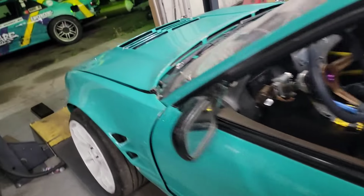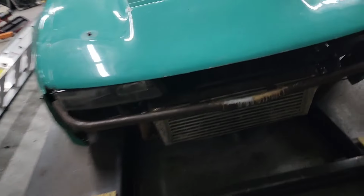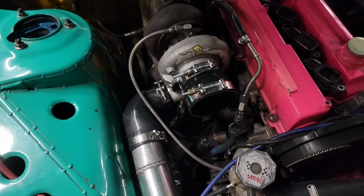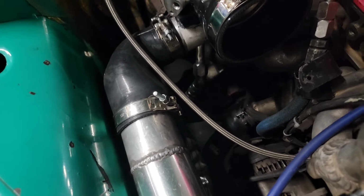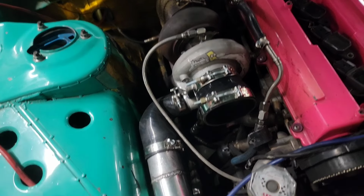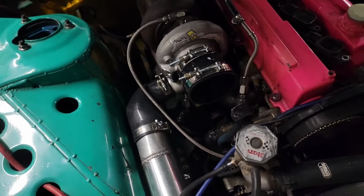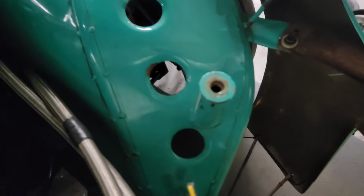We also had to do some work on the turbo, working on getting those headlights installed. It's going to look a lot better with some bricks on it. Got a coupler to run a filter. Kelly didn't have a filter set up yet. And then the oil drain was leaking. It was the older style GTX flange, and this is a regular style wide flange for the turbo drain. So we just had to kind of redesign the turbo flange with what I had available. And so we got that working, so that shouldn't be a leak anymore. And then still need to do hood pins.